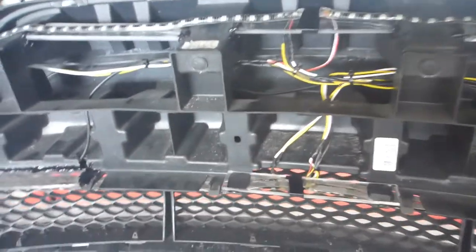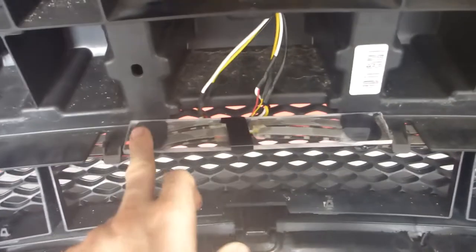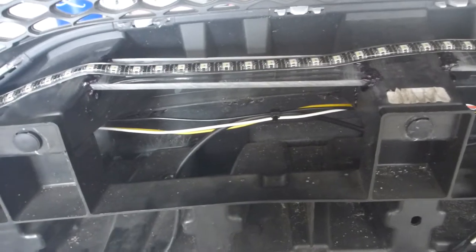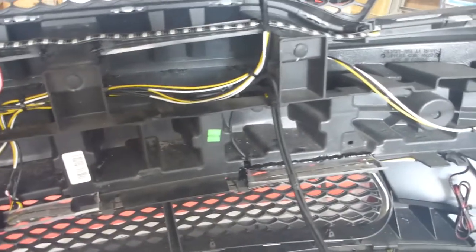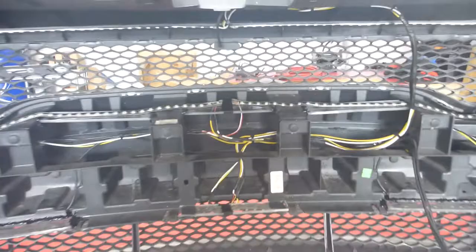One of the biggest things you may have noticed by now is that I've constructed acrylic mounting pieces — acrylic right there, as well as acrylic bridges across there, in the middle, and right there. You need to have acrylic in stock and be able to cut it effectively. I have a plastic epoxy so it is strong and it will hold. What that allows me to do is have all of these strips securely mounted, which is going to increase longevity, and also positions them accurately so we get maximum light output where we want it.